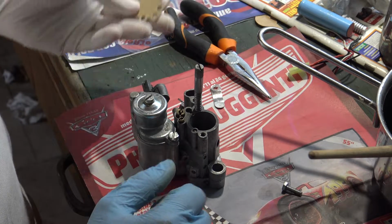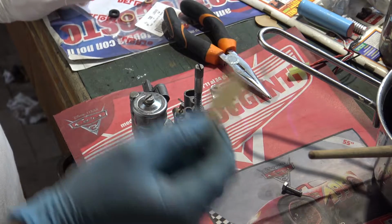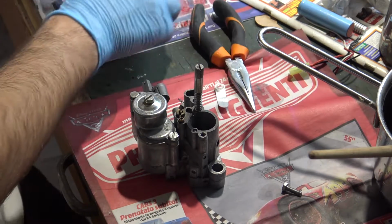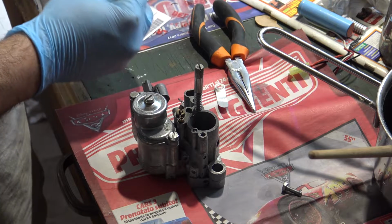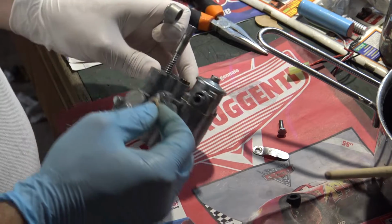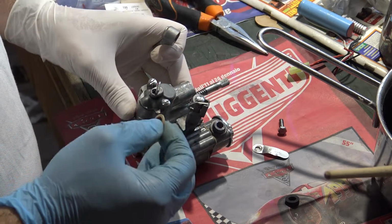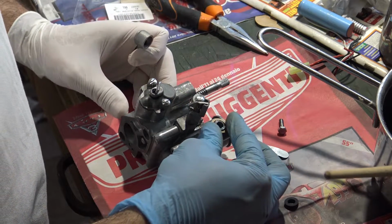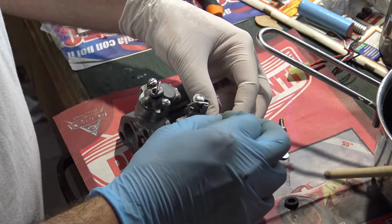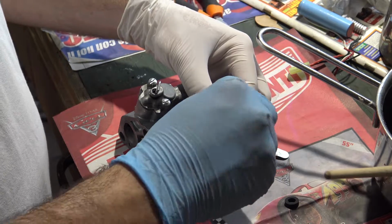If you bought a gasket kit, you may have more gaskets than you need, because these kits are for many kinds of carburetors. For instance, my kit is for SI 24 and SI 20. Oops, I forgot the fuel connection hose. No problem, you need a gasket in the base, then the fuel connection hose, and another gasket before the screw.